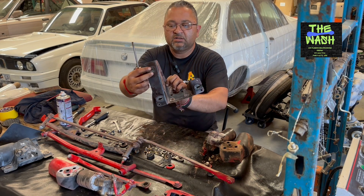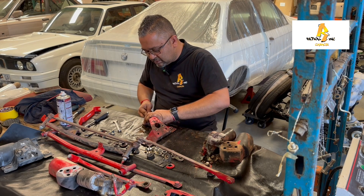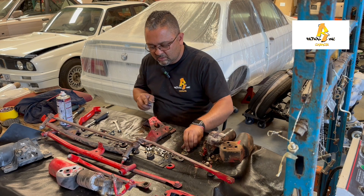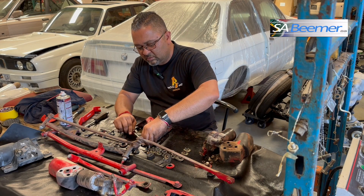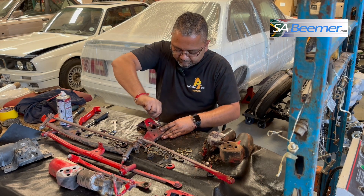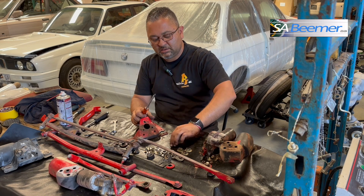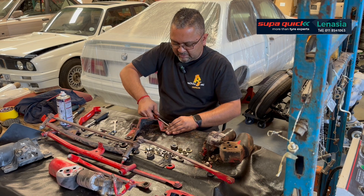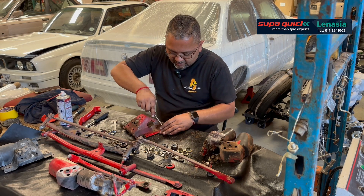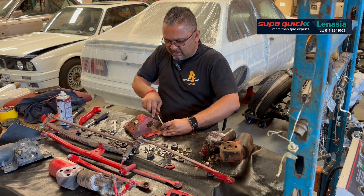We've got these bushes we need to take off, but in order to take the bush out we've got to take the metal inserts or stiffener off. You're yanking a screwdriver between the stiffener and the grommet to slide them out. These guys have been aged quite a bit but the lubricant spray helped them come out easier. This is what your grommet looks like - they're still nice and soft, not brittle. There are no new ones available because they're a very oval egg-shaped grommet.